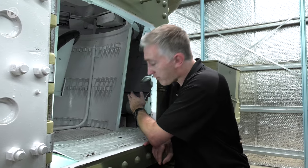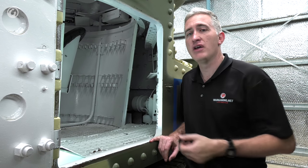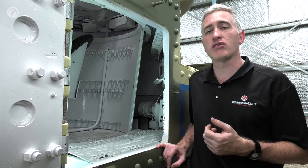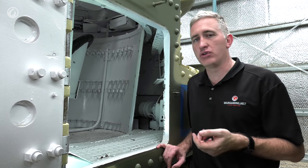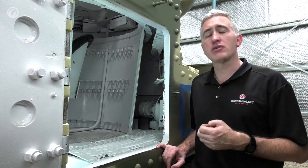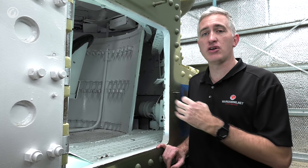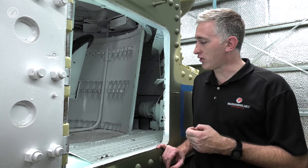This single-cylinder unit is the auxiliary motor, with a 2.5-gallon fuel tank just above it. It's used primarily to power generators so you have electrics without running the main engine — saving wear and fuel. It's also connected to the heater, which can preheat the main engine on cold days or — amazingly — heat the crew compartment, a little-known luxury in the early 1940s.